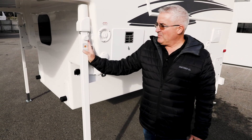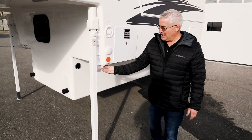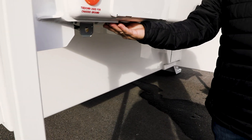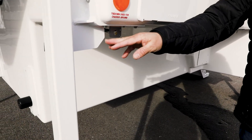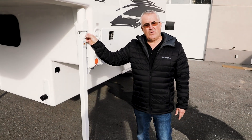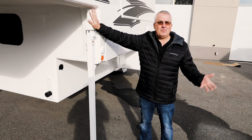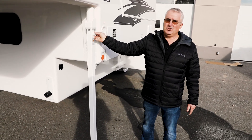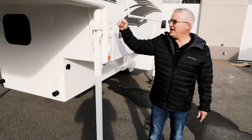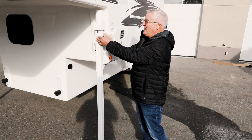On all four corners of the camper you have electric jacks. The jack brackets are undermounted on all four corners — everything is powder-coated aluminum, so it stays very nice. These do have a manual override in the event of a mechanical failure. If this little motor here were to fail, you have a plug that you could pull off, put a crank on it, and crank the jack up or down, which could prove to be handy if you have a failure.